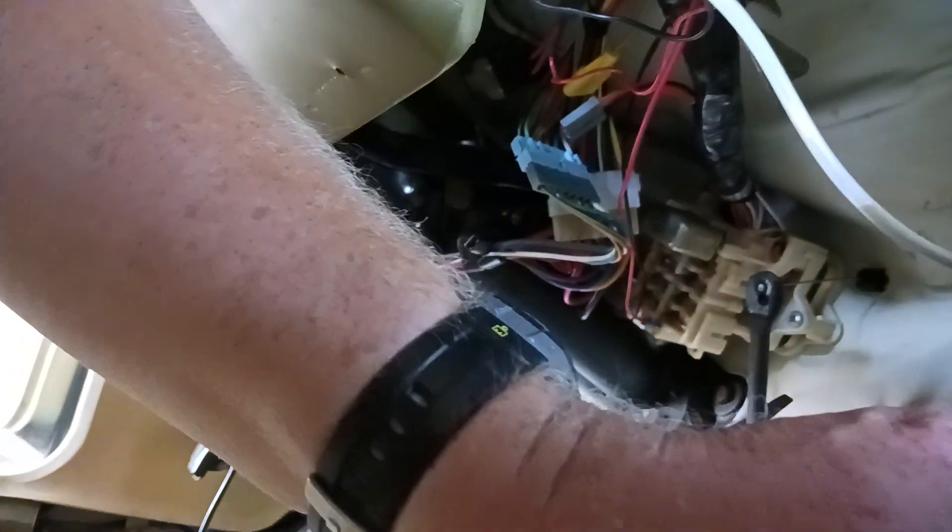So it's the same thing. You got the lights in the back. You can see you've got two wires coming out of this. Now this little light just pulls in and out of here. Got a red wire and a black wire. Your red wire is your power. Your black is your ground. The ground was a piece of cake. As you can see right next to the light is this bolt that the dash brace is on. I just put a little wire from right there to here, so it went all of a couple inches to get that done.